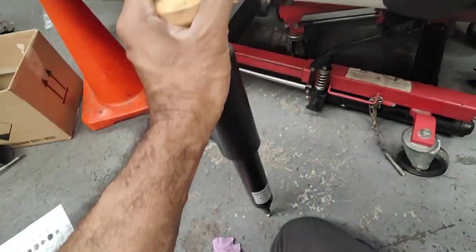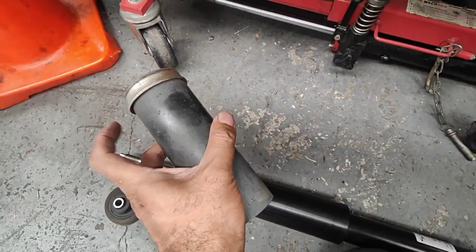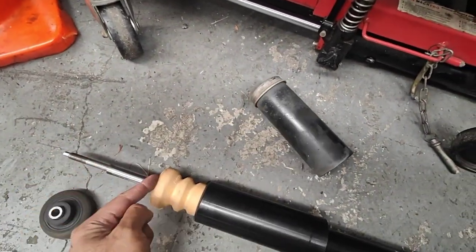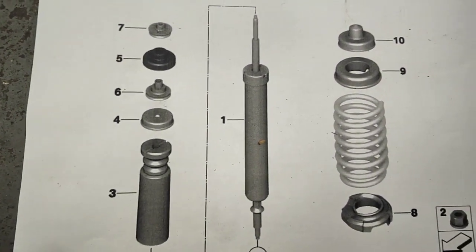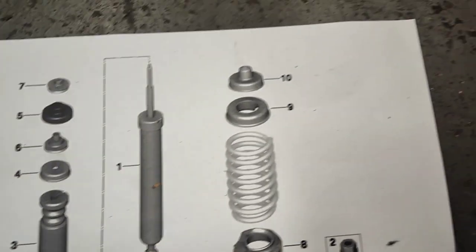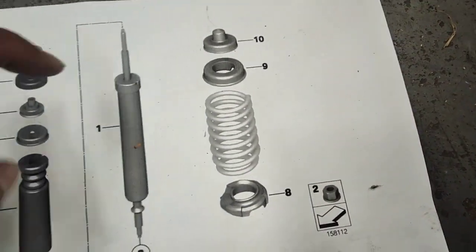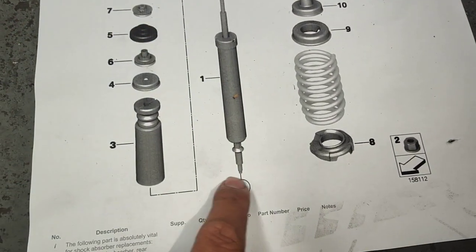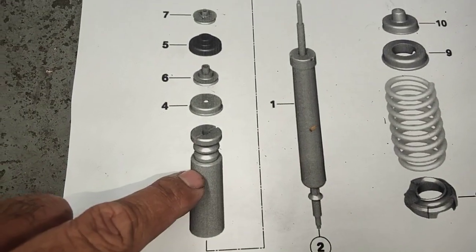Just like that, straight in like this. Then I'm gonna take that bit off here, that's gonna go on there first. Basically, if you're gonna look, this is how your shock absorber on the BMW E93 looks. That's the bottom part — the spring is separate, and the shock absorber sits on a bushing on the lower control arm.